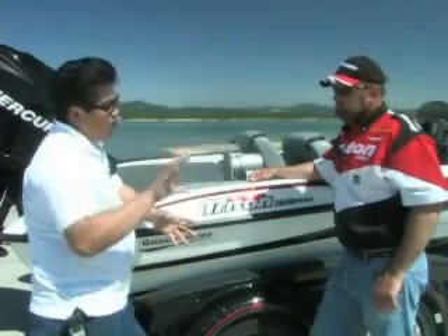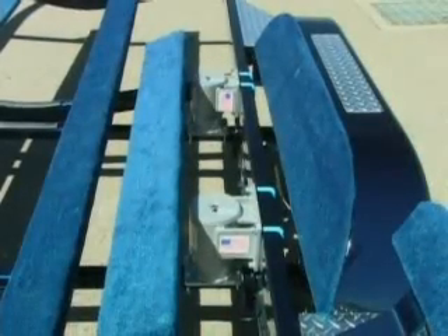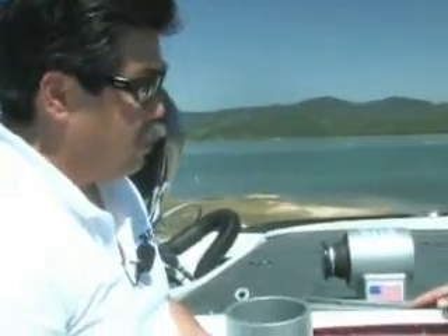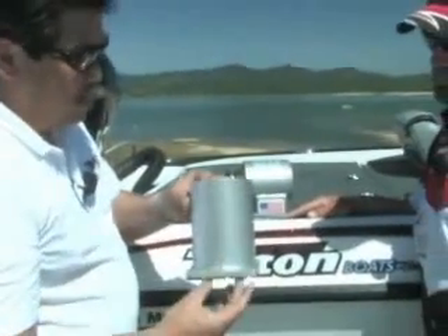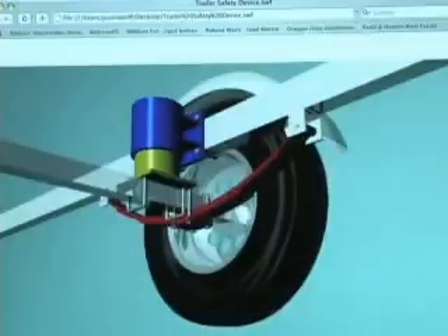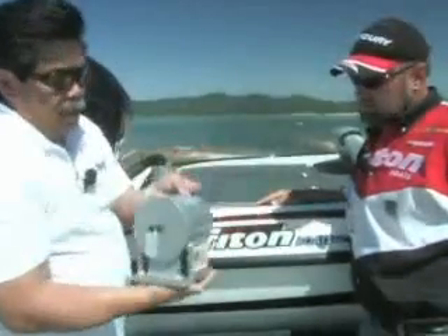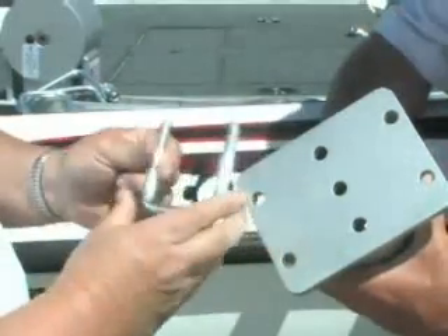This device does two things. It's bolted to your frame rail, and it's also bolted to the axle bar. This allows everything to stay perpendicular and in line until you get home. This unit here is the bottom half of the canister. This gets mounted to the crossbar that holds the axle. There are two U-bolts here that go and get mounted on that axle bar. This thing floats up and down with nothing happening.